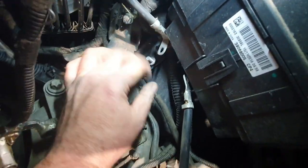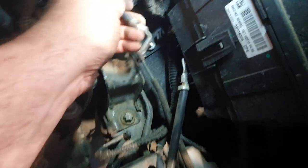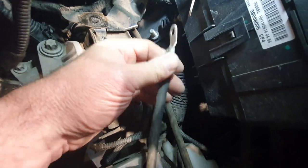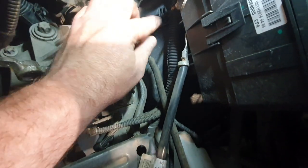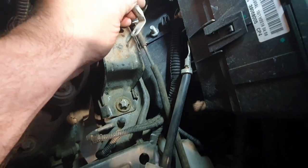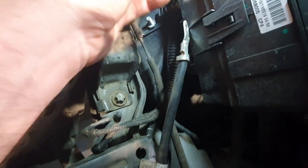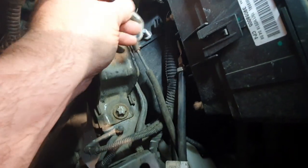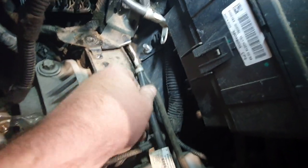In all fairness it doesn't look very corroded — it's nice and shiny, no corrosion, no pitting, and it hasn't been loose. But I'm going to do this job methodically, so we're going to clean these terminal points up and the ring terminals as well. Build this side back up, then take the one off the starter motor — which in all fairness did look a little bit corroded — and start her up to see if we've fixed it.